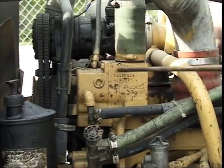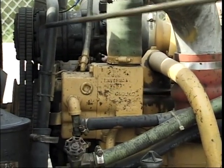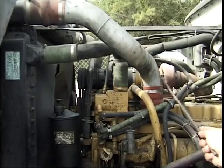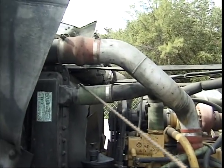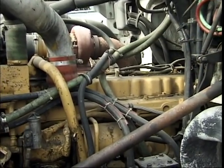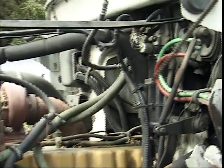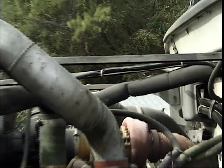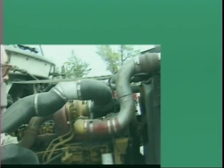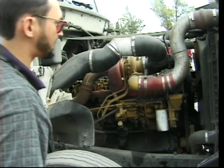The water pump is securely mounted, has no damage, no leaks and the belt's tension is also appropriate. The engine oil level should be normal. The coolant system's joints should have no leaks. All visible pipes and electrical cords should have no damage. All rods and fittings shouldn't be broken and should be well secured. We now move to the right side of the vehicle. In real life, you must inspect that side's suspension, wheel and brakes. But on the test, you only inspect those items which were not seen from the driver's side.